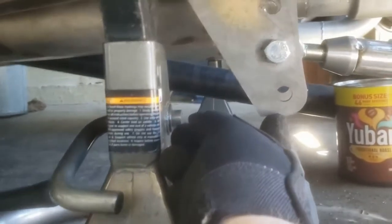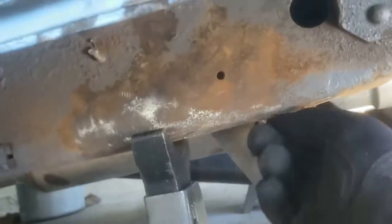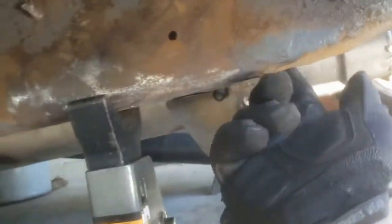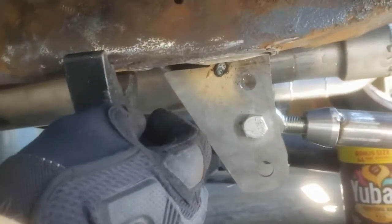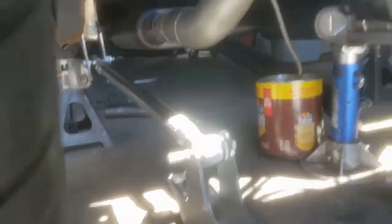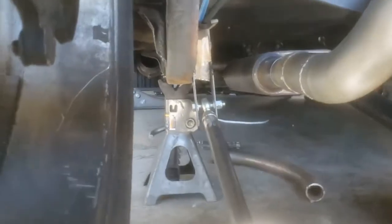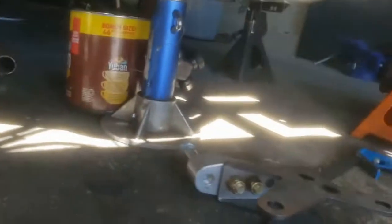This tab would put me about three and a quarter inches off the ground, so I might have to chop that off so I can still get clearance. I'm running in this hole up here, not this lower hole — I just wanted the extra hole for adjustability, and there's another one up top. I'll have to drill that hole out. I'm going to run the coilover bracket here, get my spacing left to right, and pack these guys in. That link's pretty level. Once I get the coilover brackets tacked in, I can mount the coilovers up top and get this at ride height and see where she's at.